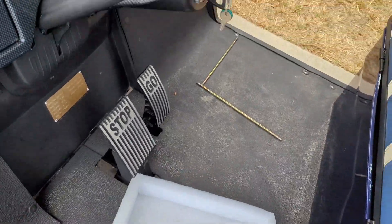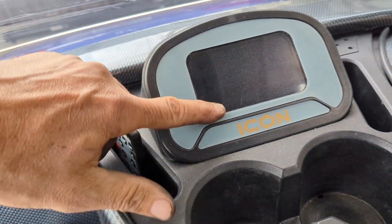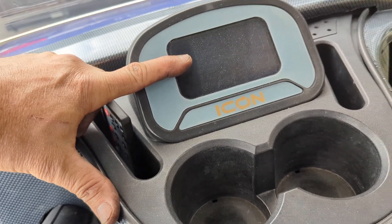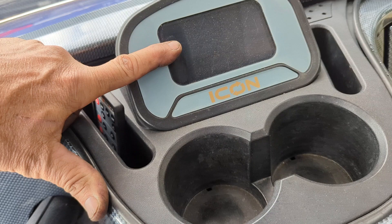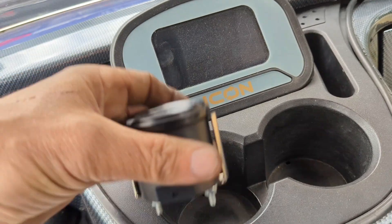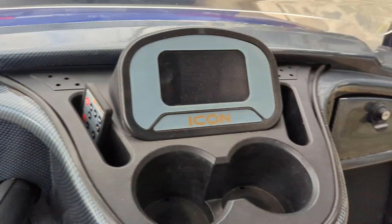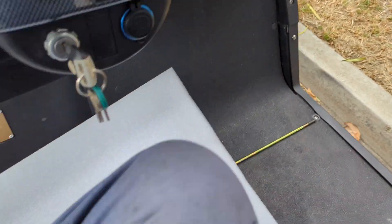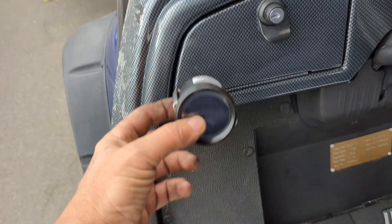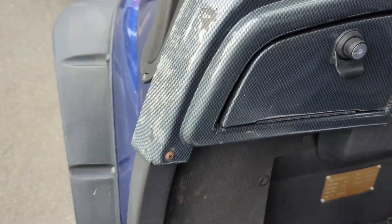Unfortunately, I talked to Allied — the Icon has a data dashboard that does have a battery fuel gauge that displays here, but the Allied does not communicate with the Icon, which would be really nice so that the data would present here and accurately show the battery's state of charge. But at this time it does not, so we're going to use the Allied fuel gauge, which I like a lot. Looking at the dash, I could not find a spot that installed cleanly unless I used a tachometer gauge holder up here. The customer didn't want it down near their feet, so we're going to locate it in the back.